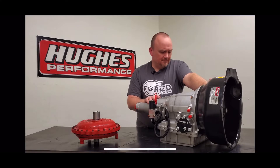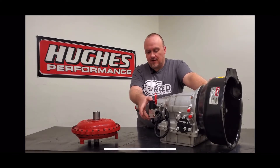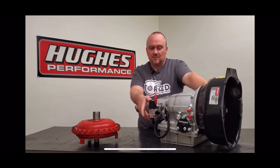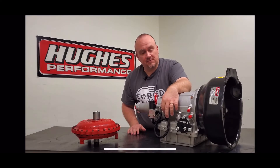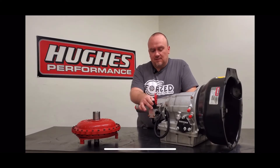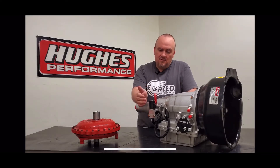It's got a universal bolt-on shift arm so it's going to work with any shifter out there, no matter what Chris chooses. Just a really simple package to install, very low maintenance. You may also notice this apparatus here — if you've watched any of our videos on our channel you may know what this is. This is one of our torque converter dump valves. With this we're actually dumping converter charge pressure as oil is entering the converter and exhausting it back to the pan. I've got a nice charge pressure sensor port here so Chris can data log that through his FuelTech.